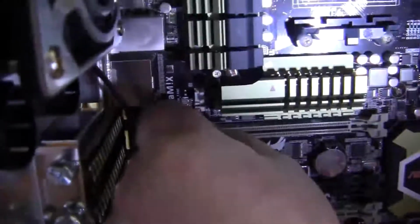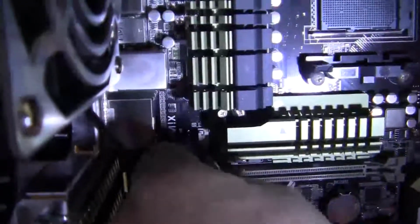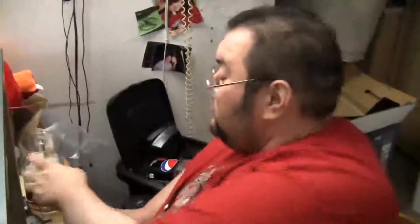So here you go. Oh, and here's an interesting thing I just noticed. See on the top how it says CPU fan 1 and auxiliary? I'll take a look in a second. Yeah. Okay, see how it's in? And that extra pin is lying underneath? Yep. Okay. That's fine. You will get nervous because there's an extra pin there, but it's okay. But over here, if you see CPU fan and CPU optional, that's for, sometimes you get coolers now with 2 fans instead of just 1. So if you're serious about cooling and overclocking, that might be of interest to you with this motherboard. But if you're air cooling and not liquid cooling, yeah, so it's just nice to know it's there. Or another type of cooling yet to be determined.